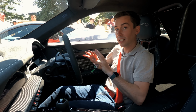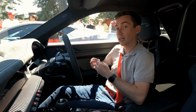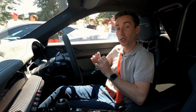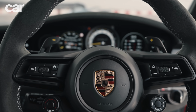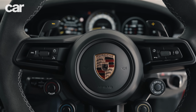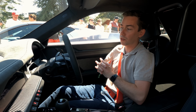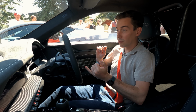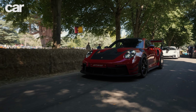they've completely changed it. Now, usually Manthey goes with a passive suspension setup, but this time they've got a semi-active two-way damper, which means that they can keep the configurability of the GT3 RS, and you can change the bump and the rebound down here on the switches, which is obviously a massive selling point of the car. So that was super crucial. And also the spring rates are up 30% and 15% front and rear respectively.